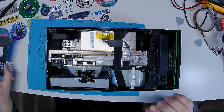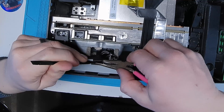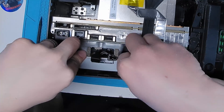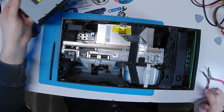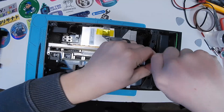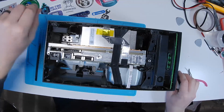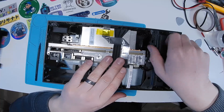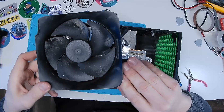Pop this out and we'll remove our optical drive. There we go — and this should slip right out. Perfect. A little bit of dust, not a big issue; I'll give that a good cleaning before we reassemble. Everything uses a Torx 8 bit, which makes this super easy to disassemble. I'm going to unplug this here as well. Massive fan — we're also going to clean that.